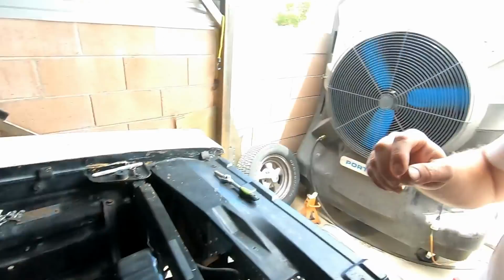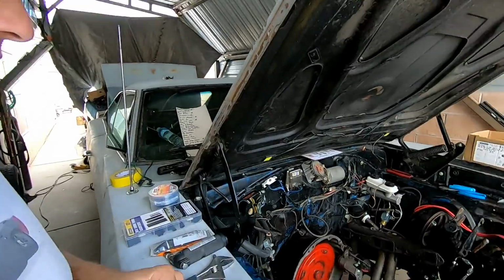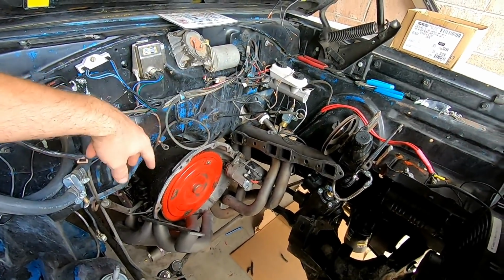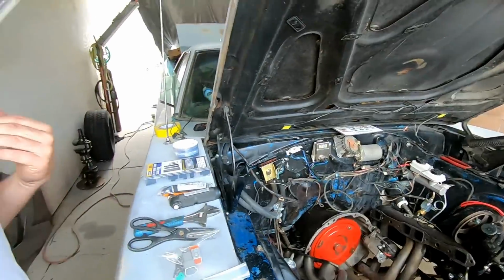I don't need that. The General Lee has a bigger cam than what Smurf does, and it still operates the headlights up and down just fine without that vacuum canister. So this has got a smaller roller cam, which has shorter duration. So it should have more vacuum, which is fine. And so I'm gonna try and clean up all the wiring, I'll loom some of it, and just get it to where it's all kind of tucked and hidden away, but not trying to spend the time to make it super show car quality, just trying to clean it up a little bit.